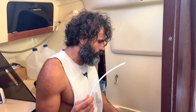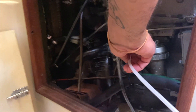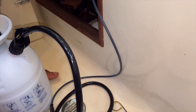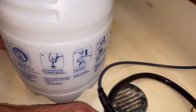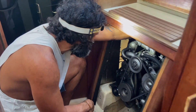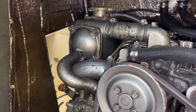I'm taking the hose and sticking it into the dipstick opening, siphoning the oil out. I push it as far as it will go so it can reach as deep as possible into the oil pan. You can hear it dripping into the pump cylinder. Another trick is to open the oil intake cap to allow air into the system, which helps with siphoning.